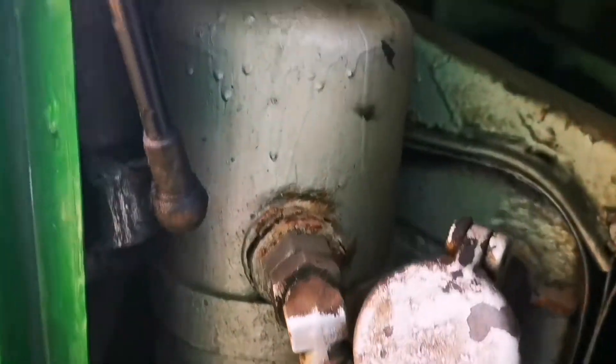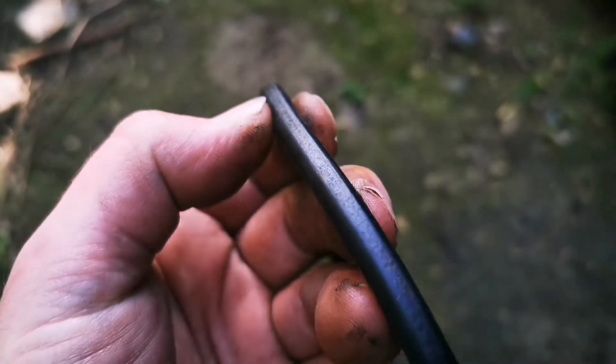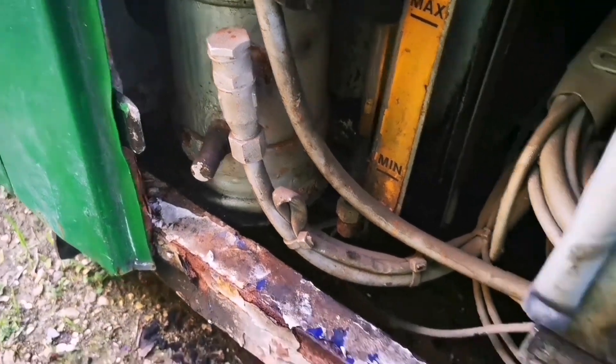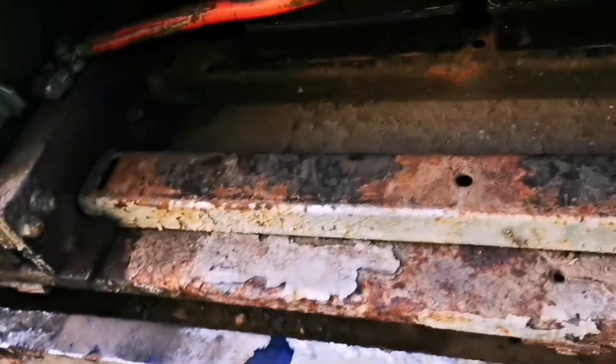There's some of the crap that's come out of it. It's pitch black, but it has taken a long time to clean all of that out. There's very, very little space under it, but that's now in bits. There are the retaining lugs, there's the lower seal - which I would say isn't bad, but you can see the whole lip of it is disintegrating, mainly caused by how badly it corroded around the bottom of the torpedo. It was properly rusty. The circlip I've cleaned up - I had to beat that out with a cold chisel and hammer because it was so corroded in. But anyway, it's come apart.